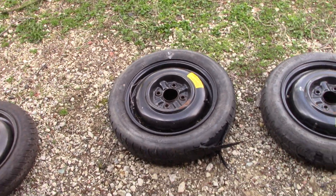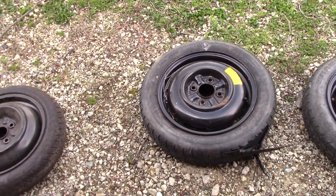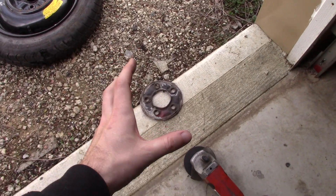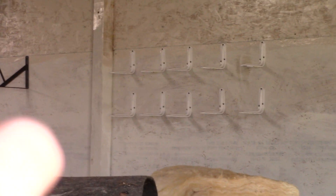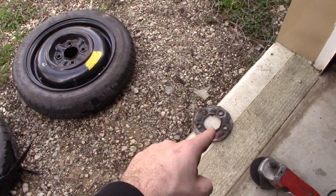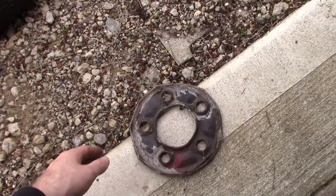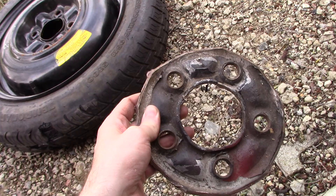If you have the tools, you can obviously use a torch or a plasma cutter, handheld plasma cutter, and cut out the centers very quick and very easy. Eventually what I will be doing is getting a whole bunch of these centerpieces of different bolt patterns saved up. I'm going to have them over there on my wall where you see I've started making hangers. I'm going to label all of those hangers for different bolt patterns and I will know exactly what they all are. It does not matter if it's a 14-inch, a 15-inch, or a 16-inch diameter rim because that bolt pattern won't change regardless of the rim size. So now I can take that bolt pattern — which is off the GM Cutlass, that square body, W-body — and put it on any donut tire that I want.